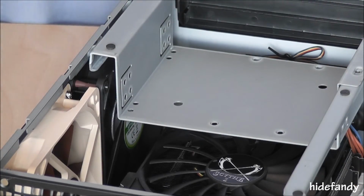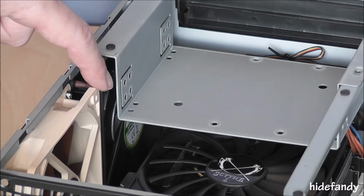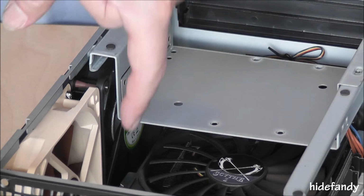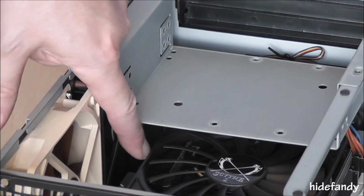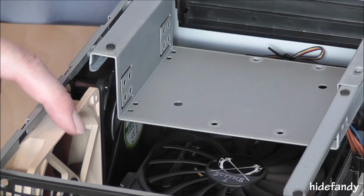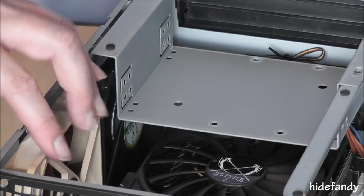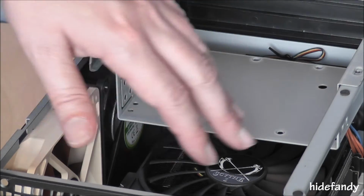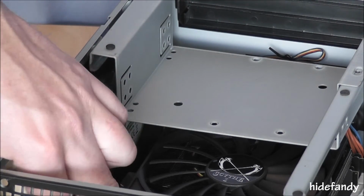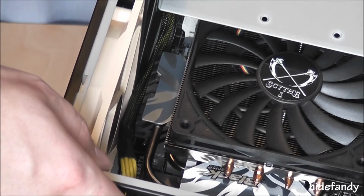The other thing I will mention is that the second fan here, most of the airflow is blocked, but it does have the additional benefit of directing what airflow does come out right across the CPU area. However, again, that's one of the main reasons why I chose this to be my main inlet fan, as the path is less blocked and most of the airflow will still flow over the CPU area, and most importantly the heatsink for the motherboard.